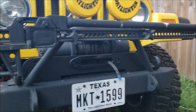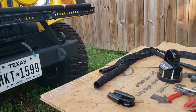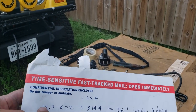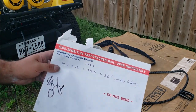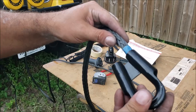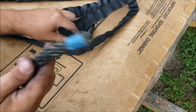I've been practicing about two or three times but this is my first official job, so let's just get an idea how it's done. I pulled out a bunch of cable to work with. You're going to have to convert it to metric - this is half inch, there are formulas out there. Go on the internet, watch those two videos I'm going to link. We're going to need a bury length of 36 inches, and we're also going around this thimble so we need to add 8 inches.